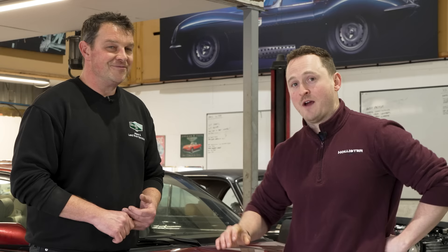The plan is to take the automatic gearbox out and put a manual in. To give it more oomph off the line, we're going to put a different differential in — change the diff ratio for better acceleration. Then we're going to put a quaife centre in it so you've got really good traction. And then we're going to completely strip it out and every body panel is going to be transformed into carbon fibre.